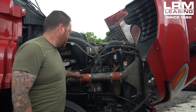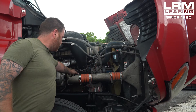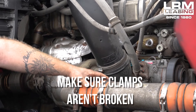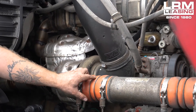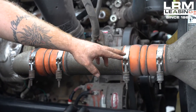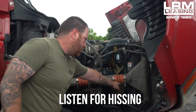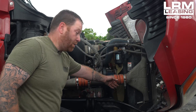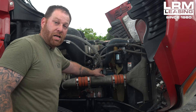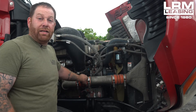Now we're on the passenger side. Here's our turbo, which is connected right to your air filter. You want to make sure that all these connections are good, the clamps are not broken, nothing loose — allow it to suck in air. Right here you have two hoses — one here and one there — and you want to double-check the clamps. If the clamp's broken and you hear hissing, then you know you have a bad clamp. Or if you hear hissing and the hose has a hole in it, that's another problem. Make sure all of this is sealed. If you have good air going across it, you're going to have that power. Anything that's leaking, you're not going to have the power you need when you're demanding it.